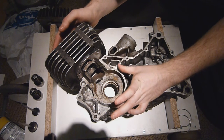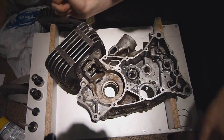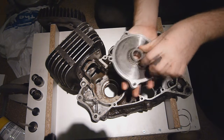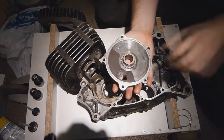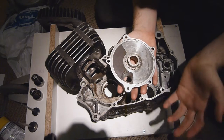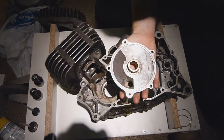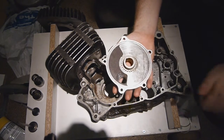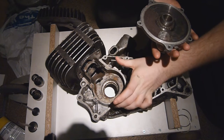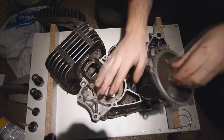To do this, the actual crankcase here is a compressor. To demonstrate this, we shall go through a full cycle of the two-stroke. If we push the piston up just until it shuts off the transfer port and exhaust port — we have this valve in the crankcase. This is a disc valve engine, so the valve is actually a rotary disc which shuts off and opens this inlet here, which goes to the carburetor. On other two-strokes, this can be a reed valve working on pressure, or even the piston itself. As the piston goes up, the inlet valve opens. Because the piston is a sealed unit going up, it's making the volume of the crankcase bigger, which means there's a negative pressure within the crankcase that draws the air-fuel mixture through this valve and into the crankcase itself.